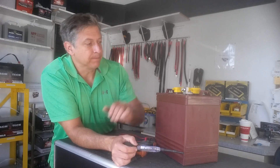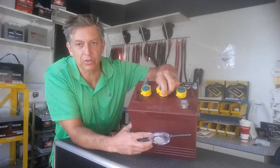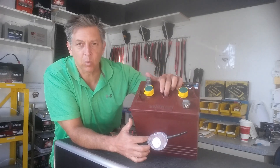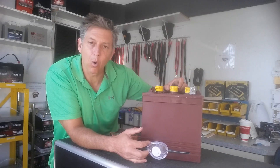If you have not been using your trailer, you probably want to go in there and start powering everything up and doing a little preliminary test as if you were out there without hookups. If you haven't checked the water on your battery, it's a good time to start checking. You want to open up the cell and look inside your 12 volt or your 6 volt battery. 6 volt batteries have 3 cells, 12 volts have 6. You want to make sure the plates are covered with water. Don't be too alarmed if the plate got a little bit dry — you're not completely done. But you want to do some checking, some testing, and some charging before you go out there.